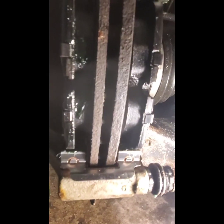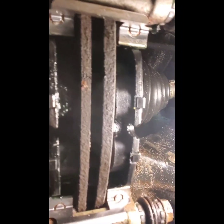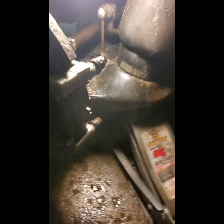One thing to note is the silver shims that these things ride on, they have to be centered so they don't rub on the disc surface itself. Because otherwise you're going to ride down the road and hear this squealing noise and not be able to figure out what the crap that is. So save yourself a heartache and take care of that early on.